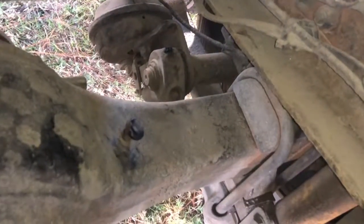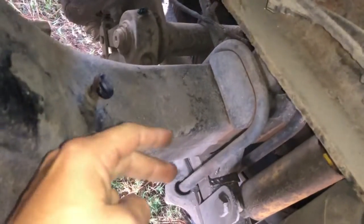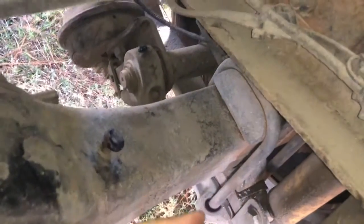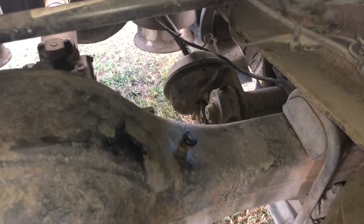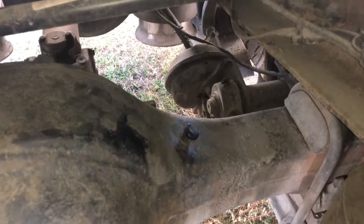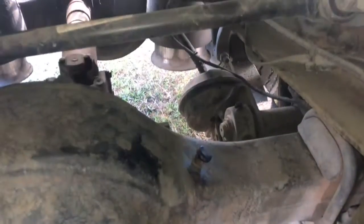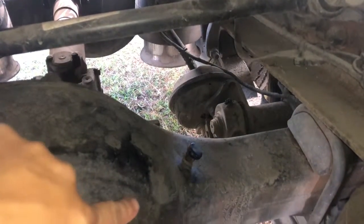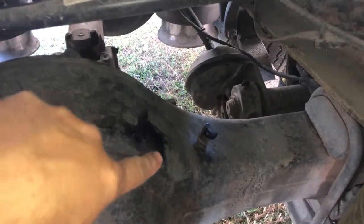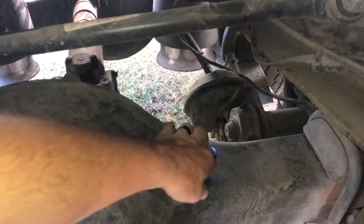If these on both ends down there are clogged up or not freely moving — it's supposed to be bouncing around while you're driving — that's what releases the pressure that builds up inside. That will prevent your seals from busting. I didn't know that. This is knowledge I just want to share. I'm sure a lot of older owner operators do know this, but this is for people that are new to the business. It won't prevent it 100%, but it can prevent it from happening all the time, as long as you keep it clean and free of movement.